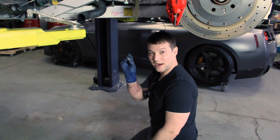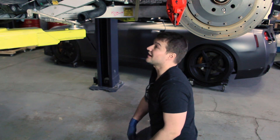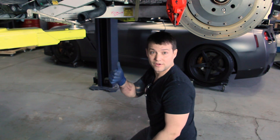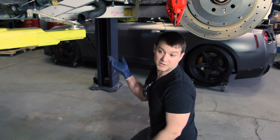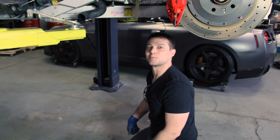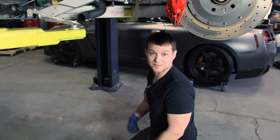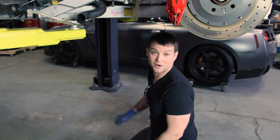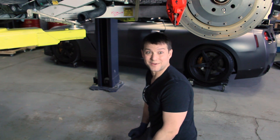This is the last piece — it's the ground nut for the strap that goes to the fuel cell tank. We have the filler neck out now. All we have left is the two support straps and then we can pick the vehicle up off the tank. Since we have a lift, we're just going to set the car down, put something underneath the tank, and pick the car up off of it. After this, we see what kind of fuel pumps we have.